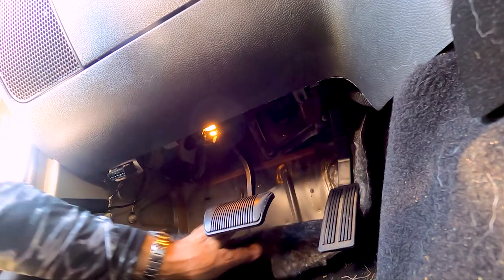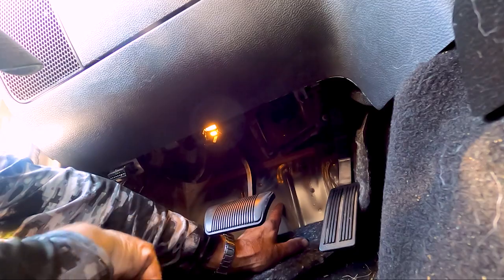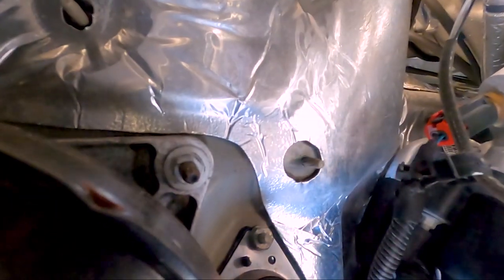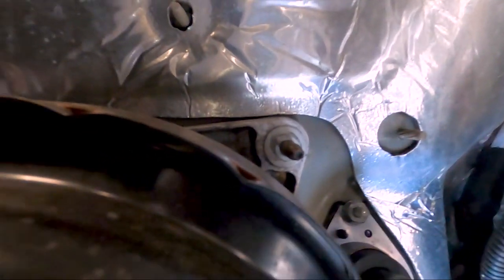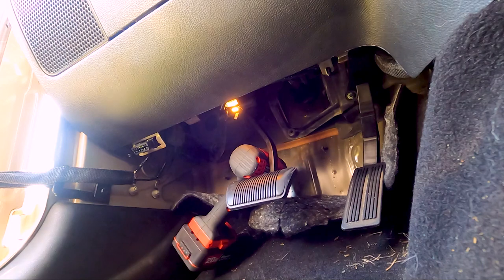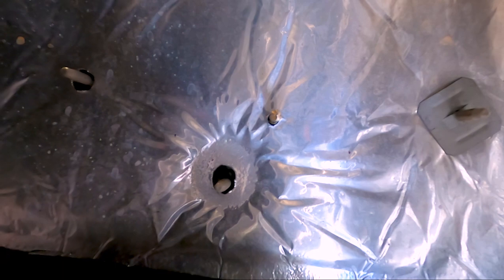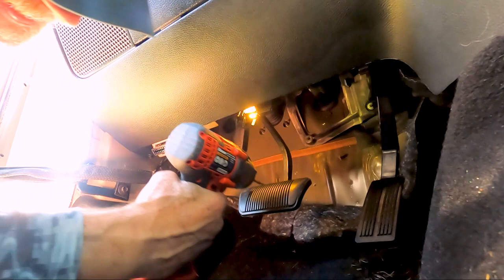The breakaway and ready brake cables will enter the compartment directly behind the pedal, so check the firewall inside the engine compartment to make certain the area is clear. Now, drill a hole right behind the brake pedal, then, leaving the bit in the hole, check the engine compartment once again for clearance. Drill a second hole, about an inch to the side of the first. Replace the carpet and cut away a small access area.